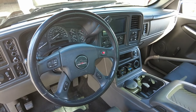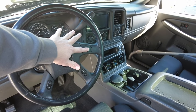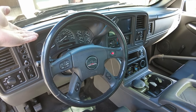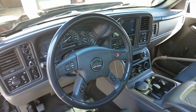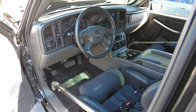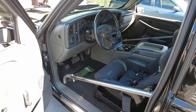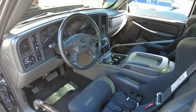So what this does is I will come to a stop, put my foot on the brake, press the button, go full throttle, which will disable nitrous and activate the two-step. So while I'm holding this, foot to the floor, RPMs can climb to about 4,000, and then as soon as I let off the button, it will disable two-step and engage nitrous, and nitrous will be shooting in probably like a foot out or something like that. I haven't done it yet, all-wheel drive, and I'm still playing around with the two-step, but we're gonna get it dialed in. I've only put like 300 miles on this thing so far, did one oil change, so I'm just trying to baby it right now and make sure everything's functioning before I really start to beat on this thing.